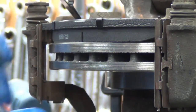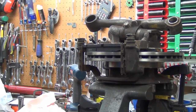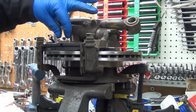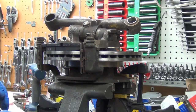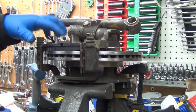They were pretty well centered at 0.900, so I made new spacers. What I'm considering is putting 0.900 spacers on all the brackets, and then having 0.100 spacers for those who want the single pistons. That way the bracket still fits both setups. It's not uncommon to shim brackets to get them centered, and basically that's what it would be - a 0.100 shim.